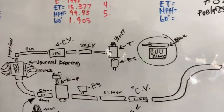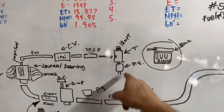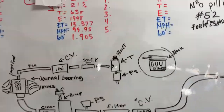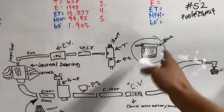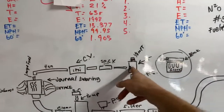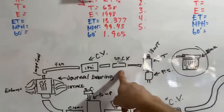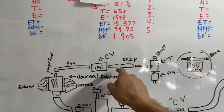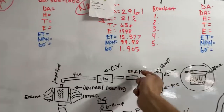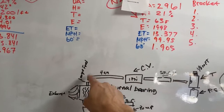So, oil feed line system — here's the little diagram. You can either do a block adapter with an oil filter, or you can do a T at the pressure sensor, which is what I did. If that doesn't work I'll move to the other option. We've got the T to pull oil from the block, a line, a shut-off valve, a control valve, and a check valve at one PSI so when the engine turns off oil doesn't continue to push through.